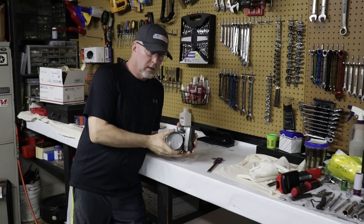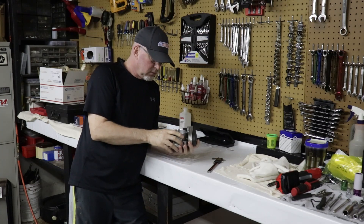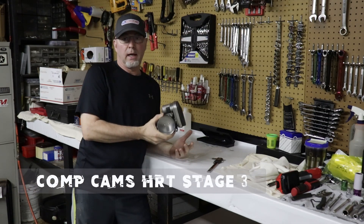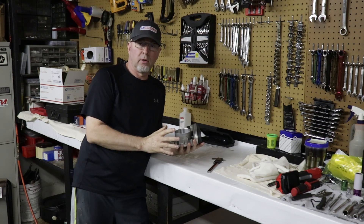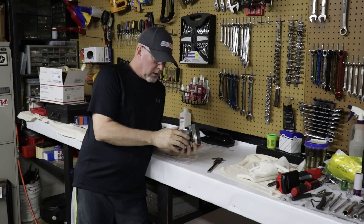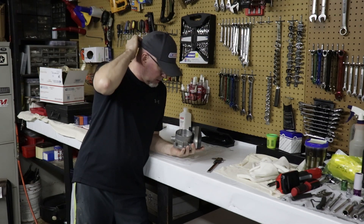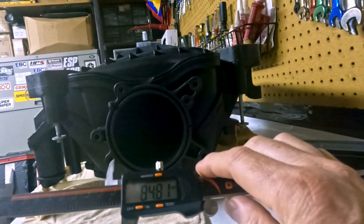Now I know a lot of guys are going to say you don't need this, it's a waste of money. I get that — on most 5.7s you don't need this, the 80 millimeter stock throttle body is good for 500 or so horsepower or maybe even more. But with the aggressive cam and heads I'm going with, I think I'm gonna see some gains. Dan agreed — I gave him all the specs of my build and he said this is the one I want. It's future proof too, if I want to go to a stroker kit. Even if it's five horsepower, I'll take it for the money spent.